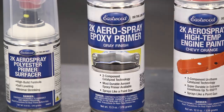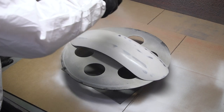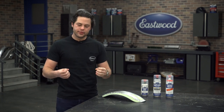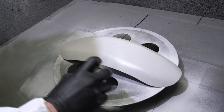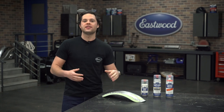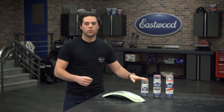Now there are a couple of different primers. Epoxy is gonna be your standard base — it's good for corrosion resistance, really tough, chemically resistant, low shrinkage, excellent adhesion properties. Downside, it's a little bit difficult to sand. Urethanes are gonna be your middle ground — a little bit more porous, but they provide a really nice finish. You can use urethanes on top of epoxy, a properly prepped surface, or right on top of body filler. It's a little thinner, a little bit easier to sand, medium build, good for filling in those little scratches and imperfections. Lastly, polyester is known for its excellent build — it's really thick stuff. You can lay it on thick over epoxy, fiberglass, bare metal, or body filler and sand it smooth. It's great for filling in small blemishes, and we do have some tiny little low spots to fill in, so that is what we're gonna start with today.